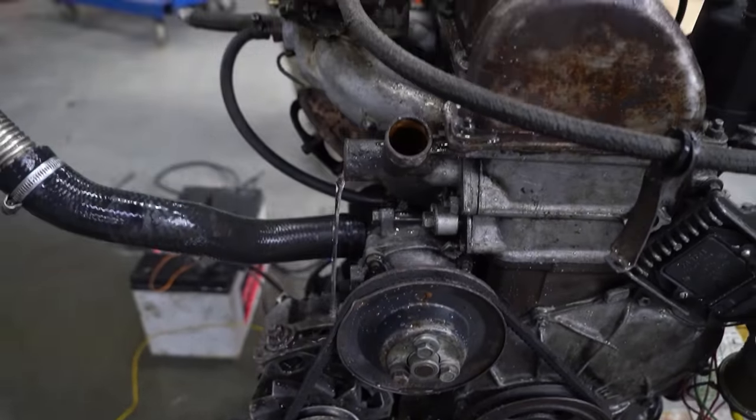So here's the situation. It does react when I move this around. You get less air and more fuel. But it doesn't want to react to throttle input. Also, barely any gases are coming out of the breather tube, meaning that apparently there's nothing blowing by the rings from the combustion chambers into the crankcase. That is truly phenomenal. What sort of miracle motor is this?